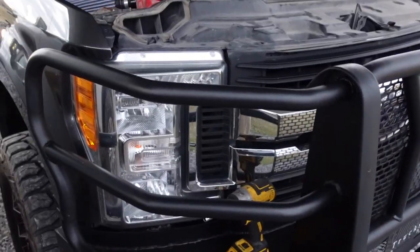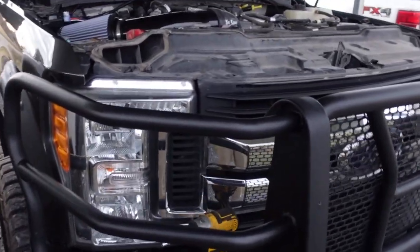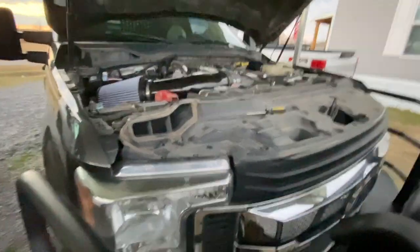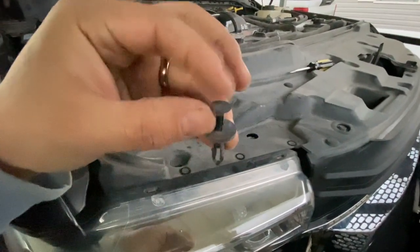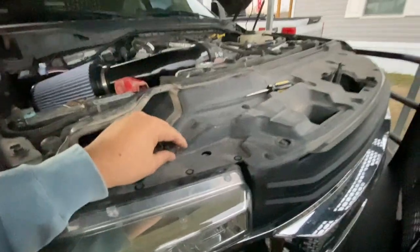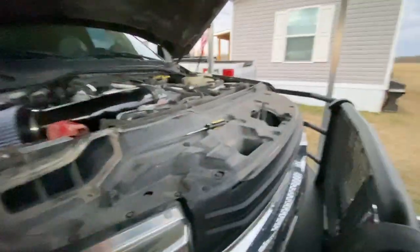First thing to install these LEDs is removing the grill, and once you remove the grill you're able to remove the headlights. We're not removing the headlights fully — just pulling them out enough to install the bulbs on the back side. He's got an aftermarket bumper so it's going to take a little bit. First step is removing about 10 to 12 trim clips on the top portion. Take a flathead and pop the top part off first, then get the bigger part — if you try to get the whole thing at once you may break them. After that there are 10mm bolts to remove before you can take the whole top portion off.